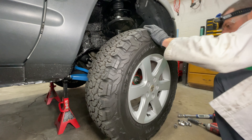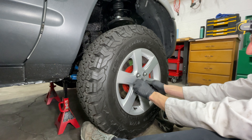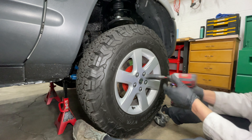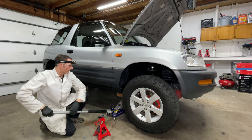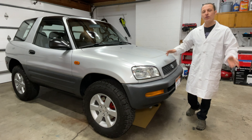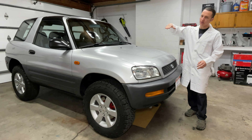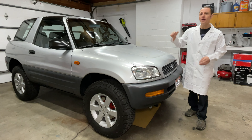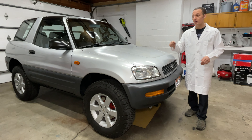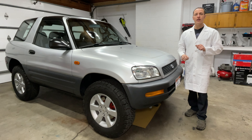Now I just need to reinstall the wheels and I'm done. I like to sit on the ground and use my feet to lift the tire into place. Always start the lug nuts by hand so you don't cross thread them. The electric impact is too weak to over tighten the lug nuts — don't do this with an air impact wrench. Torque to 80 foot pounds and you're done. I'm ready to drive my car and see what happens. I just got back from a test drive and the RAV4 was so nice and so smooth. Now when I put it in reverse and dropped the clutch, I can still get a soft thud from the rear differential mount because it does have a bit of movement, but it does not clunk. I did some aggressive fast starts, shifted aggressively, and the car never did clunk. I ripped through the gears as fast as I could — the transmission didn't grind, it just shifted smoothly. One time I revved it up, dropped the clutch, and even broke the tires loose, and it didn't clunk then either.